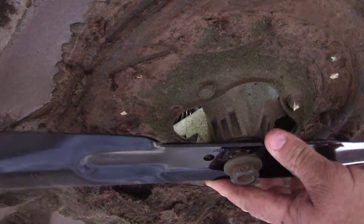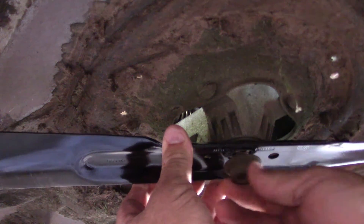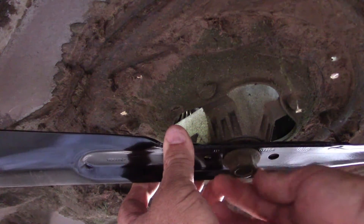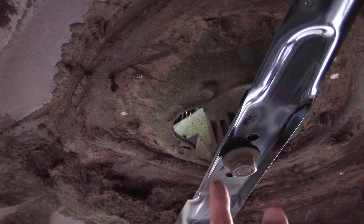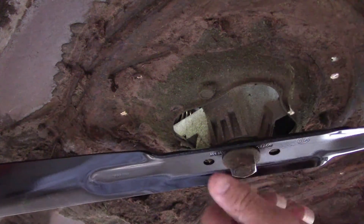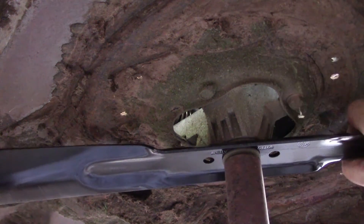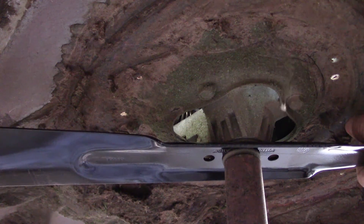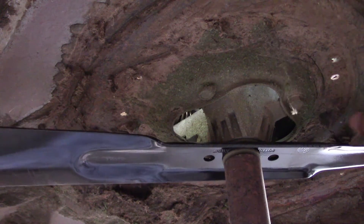The nut is started now — it's a lot easier. I'm going to wiggle this around; you can see the nut is on its star now. We're just going to tighten this down. On the blade it was also marked so you don't get it upside down — it says 'bottom' right there, which means this face goes down, which makes sense because you've got a ridge here. I've got a half-inch ratchet and we're going to tighten it down. It doesn't have to be that wrenching power you had to do with the old blades, because that spline means the blades won't spin on the shaft.